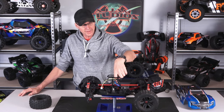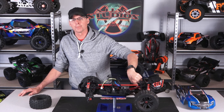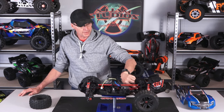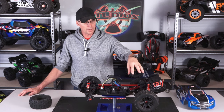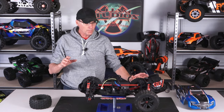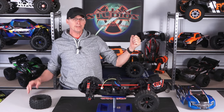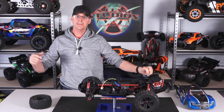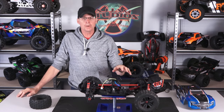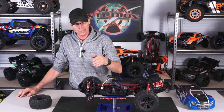When you really stiffen these up in the center, it has a tendency to wear these drive cups really fast because there's nowhere for the energy to go. It takes it all up in the hardware, and that's hard on the vehicle. Also, and I've mentioned this before as well, when you get up in the air with these things, you'll see a lot of people pin the throttle to get it to come around, but they'll hold the throttle when they hit the ground. That shocks the system so bad. And you hear about so many people just having problems with their differentials.